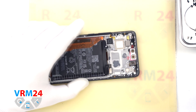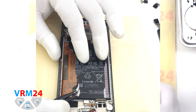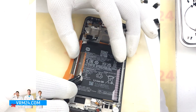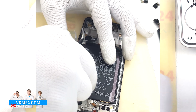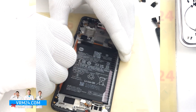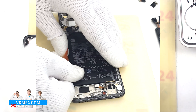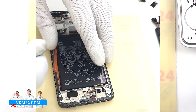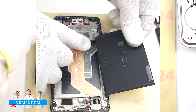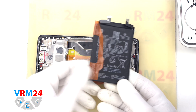And in the display frame, as we can see, we have the earpiece speaker. Finally, we move on to detaching the battery. We unwrap two brown tabs with the letters A and B. We read the description, which tab we need to pull and which one we need to unwrap. As the description makes clear, we should unwrap the tab with the letter B, which is located in the middle, as far as possible so that it doesn't interfere with us. And the white tab with the letter A, located on the edges, we carefully pull upwards. We pull the tab with the letter A upwards and detach the battery. And we see under the battery we have a transparent protective coating, which protects the interboard cable.